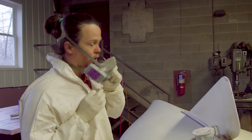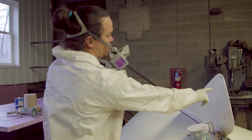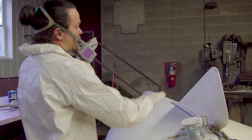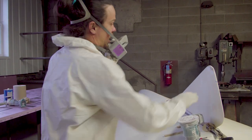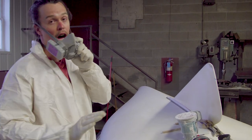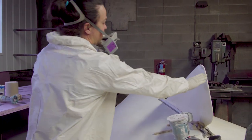Here we took this down past the gloss on this old gel coat so that we can put our new gel coat on without me having to go back in and grind it. So I've taken off maybe about an inch of that top layer of gloss that was on the old gel coat all the way around here.